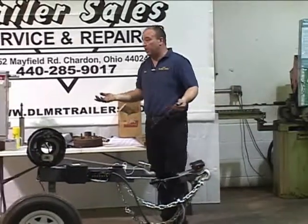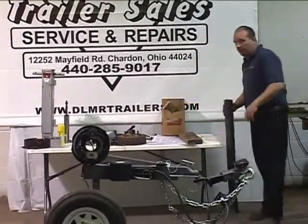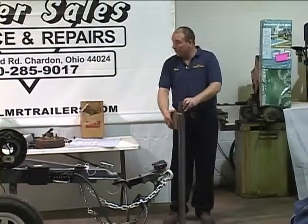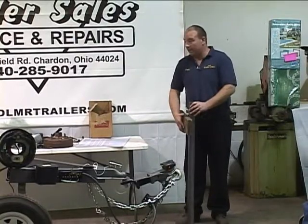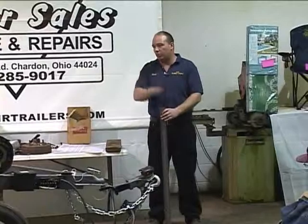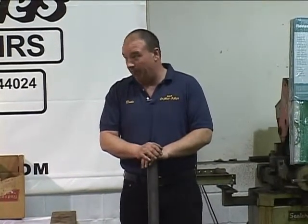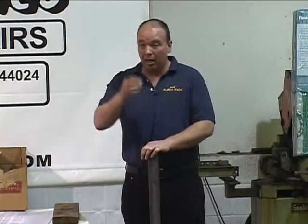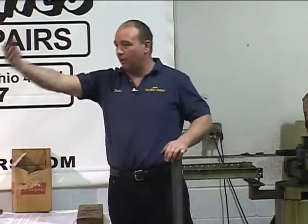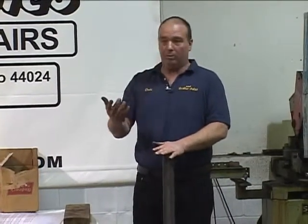I've got a steel-line trailer manufacturer right now that I'm selling — it's powder-coated and durable. But when they take two pieces of steel and weld them, there's nothing in between those two pieces of steel, and when I Rhino liner your trailer and it gets in between there, it's going to rust. I've been doing horse trailer repair since I married my wife — I was not a horse person and am still not. I am a maintenance man. I started fixing horse trailers every weekend and saw a lot of weird stuff as an automotive technician.